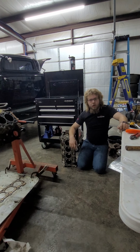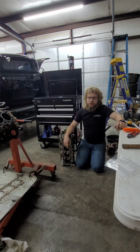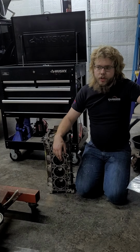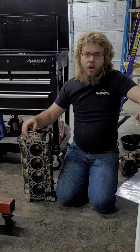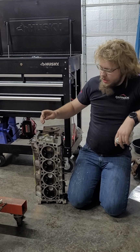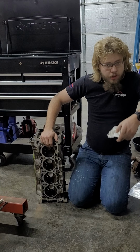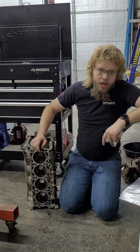And all the 4-valve heads are said to be between 52 and 53 cc's. And then supposedly you have 52 cc on the non-PI, which is actually what's in the car right now, and flat tops. So actually a really common thing to do, it's a real cool thing to do, is to take these heads and put them on a non-PI short block that has flat top pistons from the factory for mild NA builds.